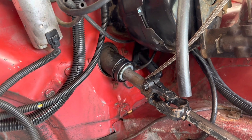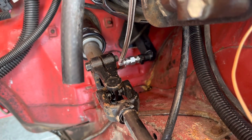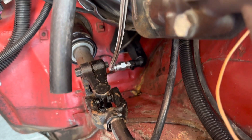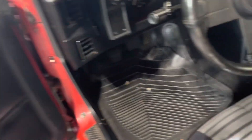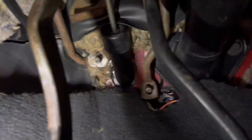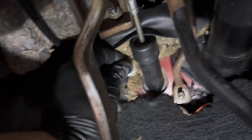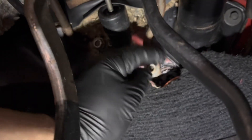There it is mounted back up. I've got one of the 4AN lines from that kit already connected into the fitting and then just run up to here, where I'm going to put a piece of tape on it so no debris gets into it. That's where it comes through, and you just simply put the nuts back on and you're done. Get those started, get that tightened back up, and it's done.